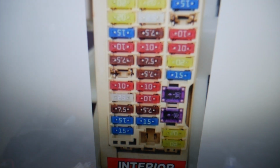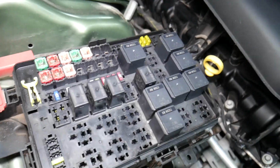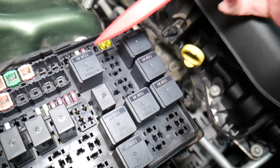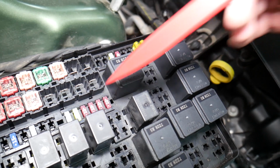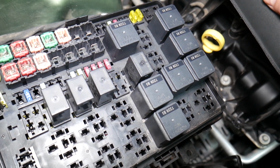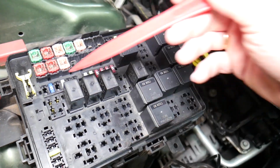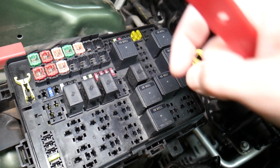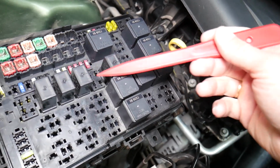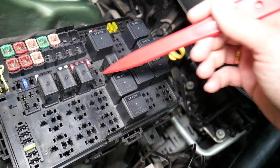Before we continue, let's explain why it's important to always test fuses and relays. It is super important to always test them, and here is a common mistake people make. Sometimes you may think that a fuse is good, or you cannot actually see if the fuse is clearly burned, and in that case you may put the fuse back, and you may end up spending money and time on parts you don't need, when all we had to do is just test the fuse. So we'll put a link in the description of the video below on how to test the fuse. It takes only a few seconds to find out for sure if it's good or bad. The same thing for relays. Some of those could be really expensive on cars, so we'll put a link in the description of the video below on how you can test relays.